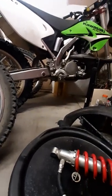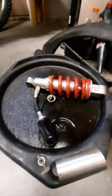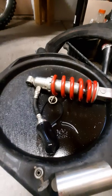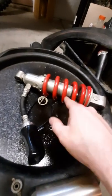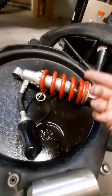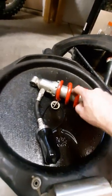There's some water vapor and oxygen, but it's never been a problem for me with the big bikes - and those shocks get mighty hot and get a hell of a workout. For a street bike especially, you're in the clear. Once you punch the Schrader valve in you can pressurize it. What cavitation describes is: this is technically like a twin-tube shock - you have the actual tube where the piston and valving is, and then the twin tube where you have the bladder.